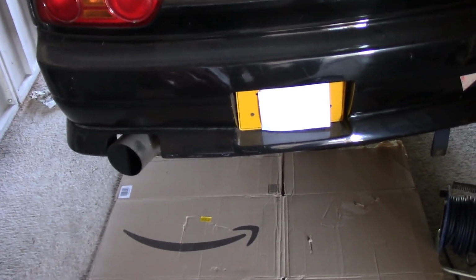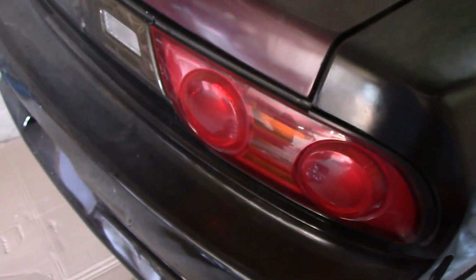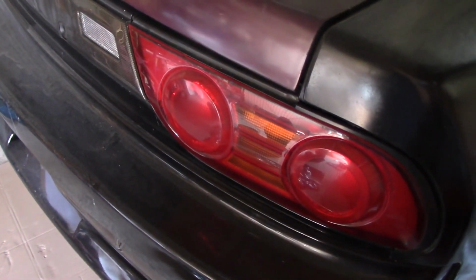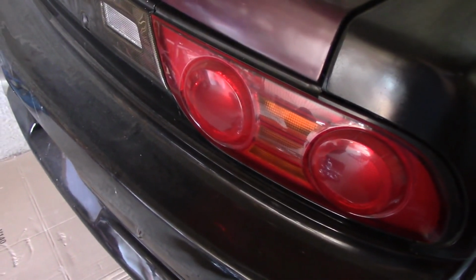Crack on with the Nissan. So today, it's going to be an interesting one. I've done this before. We're going to do the rear end restoration underneath. That means from there, a little bit further, maybe about there to there. Now on this car, that's where the gas tank is. So the first thing is, let's drain out the gas tank into a container over there if we can, and then remove the gas tank, then inspection, and we'll take it from there.